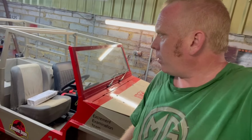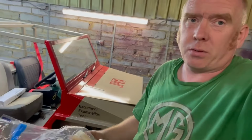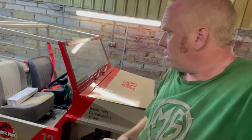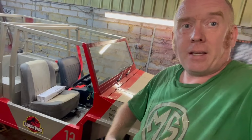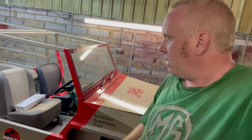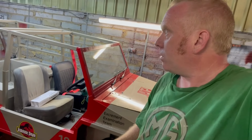I need to double check up. I'm leaving the wheels right to the last minute because I've got some new tyres for the 12-inch wheels, just so at least I've got something to drive on that's sort of half decent. So we need to double bleed the brakes again, fit the gear linkage boot and just make sure that it's in the socket. And see if we can get everything else done under the car, because then we know it's ready to go back onto its wheels.